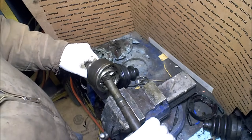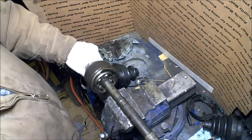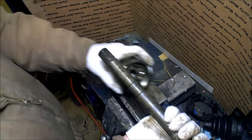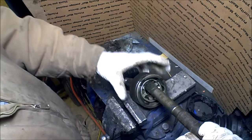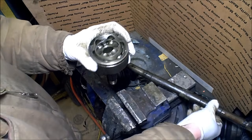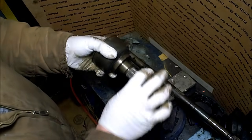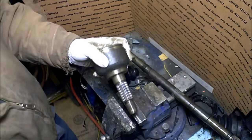What this consists of is there's just a snap ring here that keeps it from going on too far. But on this particular one, there was just another compression ring right here that takes some force — you actually have to hit it off. And there's your shaft. This is where your axle nut goes on to; this actually drives your front wheel hub. This is just a seal surface to keep your bearings from getting dirty.